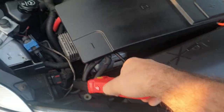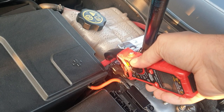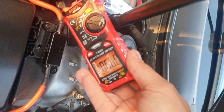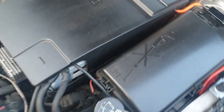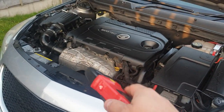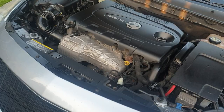No music playing, just on idle - nine amps. If I clamp the power wire that goes to the amplifiers it shows me six and a bit, so that means two and a half up to three amps is drawn only for the car when the ignition is on.